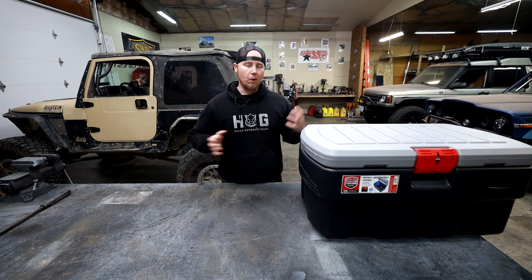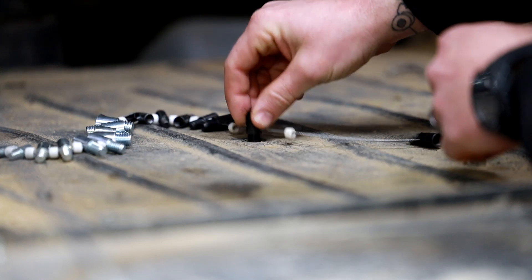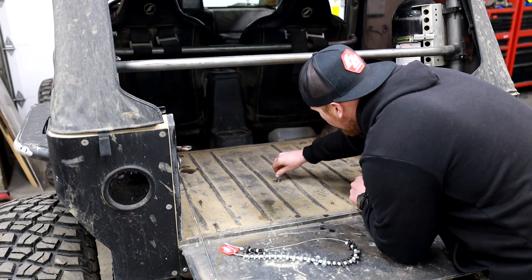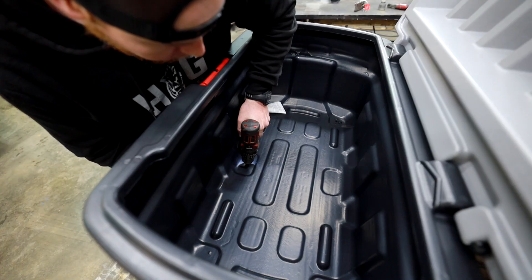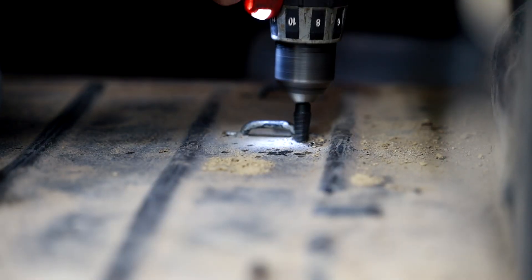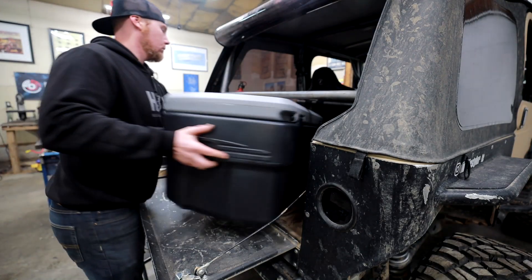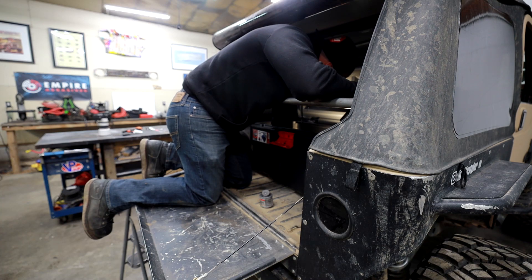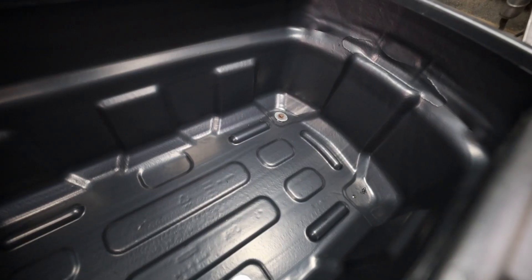To get started, I'm going to mock it up and decide where I want it. I want to use three bolts to anchor this to the floor — one going through the factory seat belt bolt location. I'm going to use a nut-and-bolt thread checker to see what the thread pitch is, find the right bolt, put the container in place to index where I want the other two holes, drill those, then unbolt the tote and use threaded rivet nuts through the floor as the other two anchor points. The factory seat belt bolt ended up being an M12 and the other two rivet nuts were M8. I kept everything metric because all the holes in the floor of this Jeep are metric. Under each bolt I used an oversized fender washer to help disperse the load so that in a rollover it's much less likely these will rip through the base of the plastic tote.